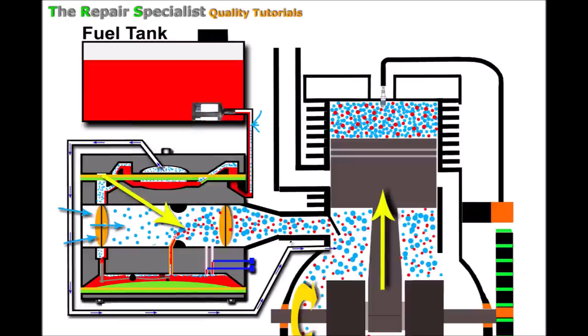Because the vacuum draws harder on the fuel, it's felt all the way up the carburetor, up the fuel pipe, and into the fuel tank, trying to get more fuel. There may be a fracture or hole drawing in more air as well, but I've found that turning on the choke does pull a little more fuel through and helps get more fuel into the engine, stopping the bog-down. When I say the engine is running, I don't mean efficiently — applying the choke when the engine is running isn't the answer. It's just telling us something is going wrong, which is what these videos aim to explain.